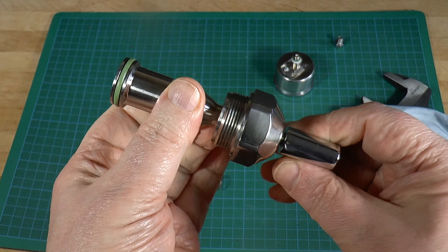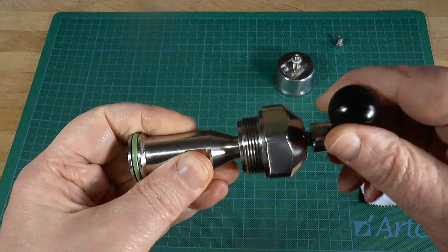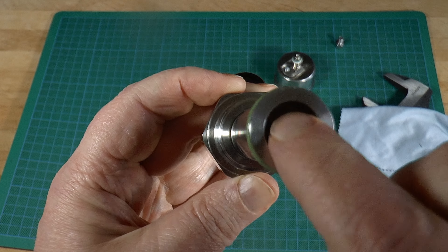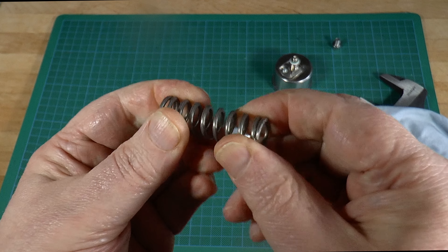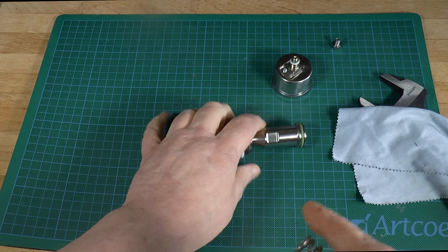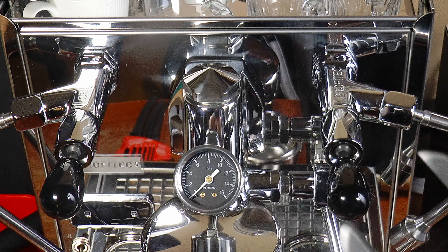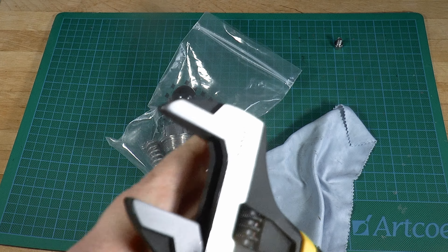There's a replacement mushroom fitted with a user-operable valve — a nice chunk of heavy stainless. Mushroom designs vary a bit across E61 groups; this one takes the brewing water up through these openings and down through a passage near the top that is now adjustable. We also have a stiffer replacement spring for the valve on the pre-infusion chamber. You didn't know that all E61 groups do automatic pre-infusion? The only tools you'll need are an adjustable wrench, a 5mm hex, maybe a 4mm hex, and a rag. If your wrench has sharp edges, round them with a file. The group is chrome-plated brass — brass is soft and easy to leave marks on.